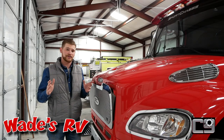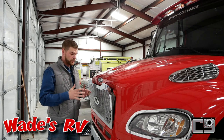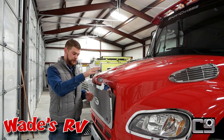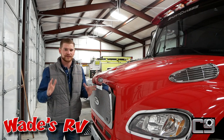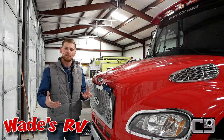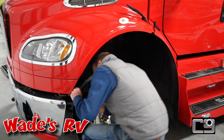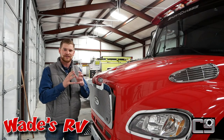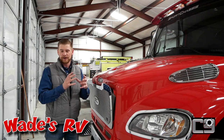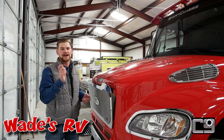This next step, if you're doing it by yourself, can be a little tricky, but if you use your mind, it's not going to be any problem at all. You have four bolts that are actually on your C9 Caliber grill. I went ahead and inserted the two bottom bolts, then I'm going to go in from the wheel wells and put on the washers — there's a metal one and also a rubber one to make sure the vibrations don't scratch up that hood. I'm going to go in through the wheel wells, tighten those up by hand, then pop the hood open again and tighten the top nuts as well.